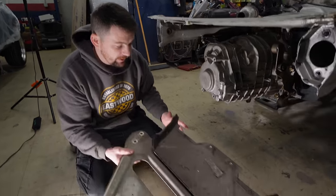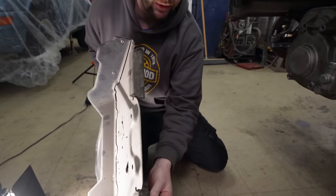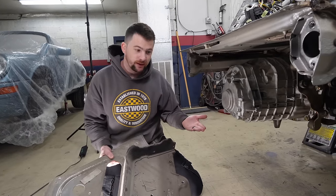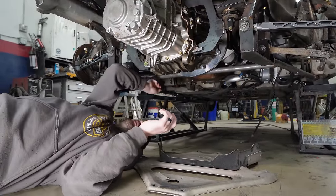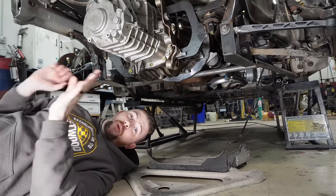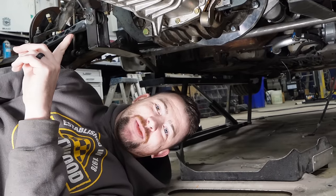From the factory, Porsche had this aluminum plate that spanned across between all the subframe components to tie them together. Not only did it add bracing, but it also added cooling for the transmission. These rubber flaps at the front are supposed to be more like scoops — they would kick the air up to the transmission to cool the diff and everything else. We need to come up with our own that bolts to our new subframes. Before we drive this thing, we have to make sure this is all braced, otherwise we're going to lose all of our precise measurements. This engine is way more torqued than the factory Boxster engines.